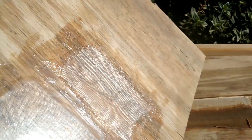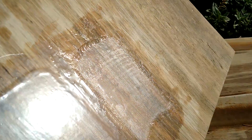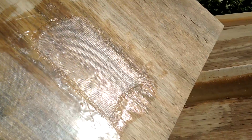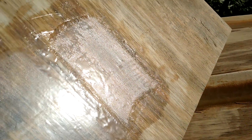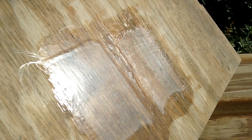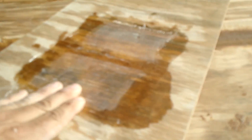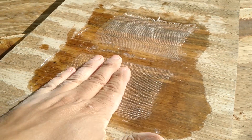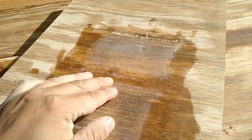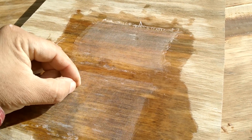I'm going to hold this up to the sun. You can see the side that did not have the plastic — it's actually a rough surface, the surface of the actual fiberglass cloth. That's about as smooth as I could get it, and that would require at least another coat. Over here, the area covered in plastic actually gave me such a smooth finish that I'm impressed with it. I think this is what I'm going to do for the boat — put the fiberglass on and then cover it in plastic for a smooth, even finish. It's just going to require a little bit of light sanding and I can paint it, whereas the other side is going to require another top coat. Definitely this is going to be the way I go with the bottom of the boat.